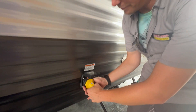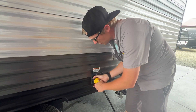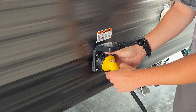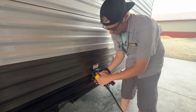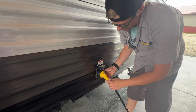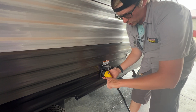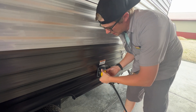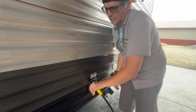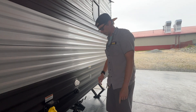In order to remove it from the vehicle, you're going to undo this black tightening ring — you're going to see the threads exposed. Once you get that all the way to the base of the yellow plug, you give it a quarter turn and you can safely remove it. In order to plug the unit back in, you're going to stick the yellow plug into the outlet, give it a quarter turn, and tighten this ring down. It's very important that you tighten this ring down — if you don't, that doesn't create the watertight seal that keeps water and elements out of your shore cord when it's plugged in.